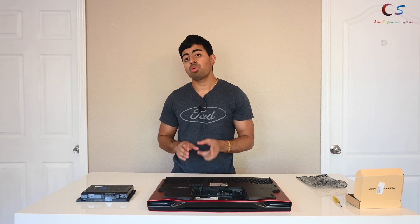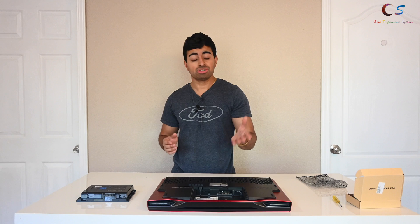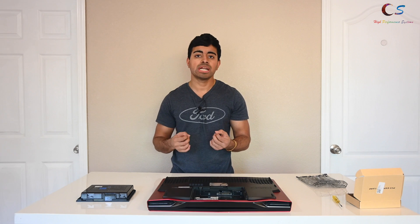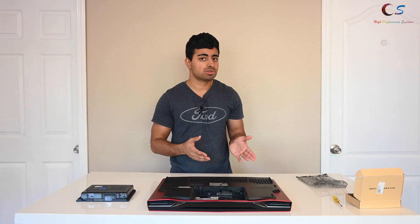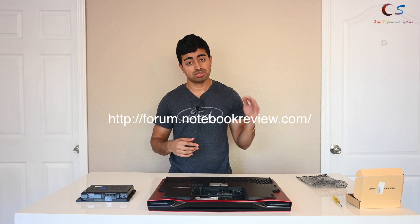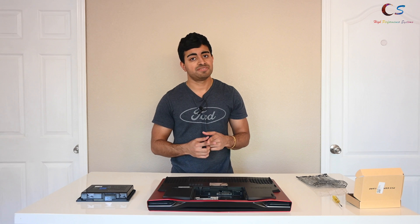So I'm going to open this up and then we'll see what to do. Before we completely open this, there's one thing I did want to mention. If you have a Lenovo or HP laptop, there's a really high chance that your laptop has a BIOS whitelist or blacklist, which means that you cannot use any Wi-Fi adapter unless it came with the computer. I highly recommend checking out notebookreview.com — there are different subforums for each manufacturer. Check there if your laptop is affected by this.